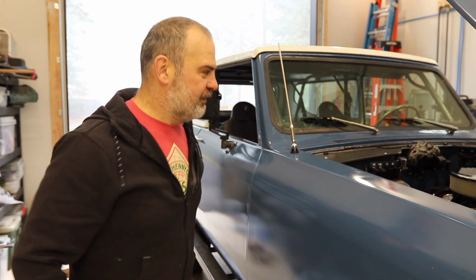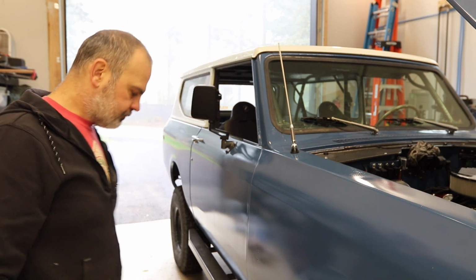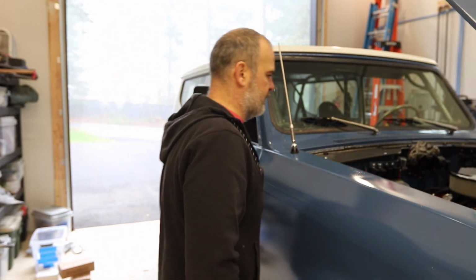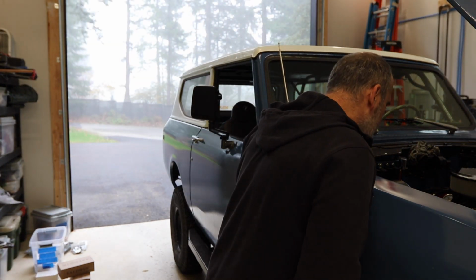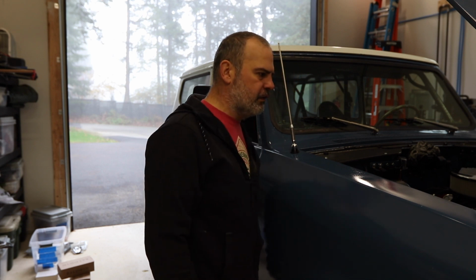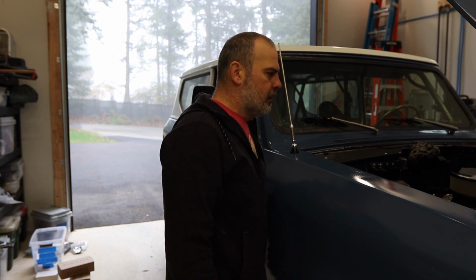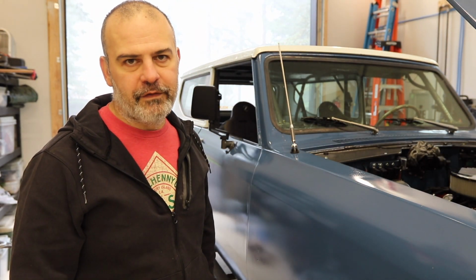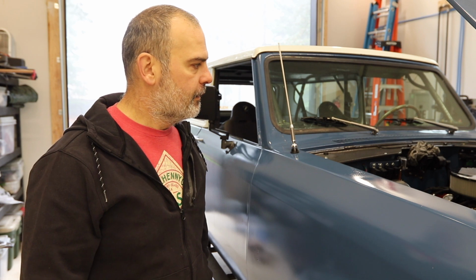Nope, still runs like crap. It has its moments. Now it feels like just ignition scatter, but it's crazy that might have made a difference. I tried to reset the fuel curves, maybe that didn't work. So I'm going to try to reset the fuel curves again, go drive it, log it, send it to Norm and see if he can figure out what's going on.